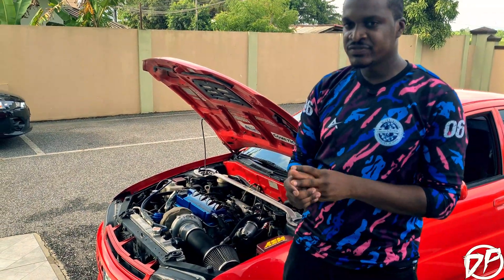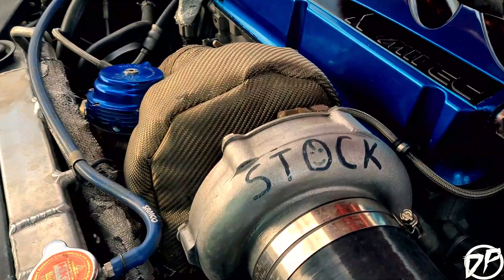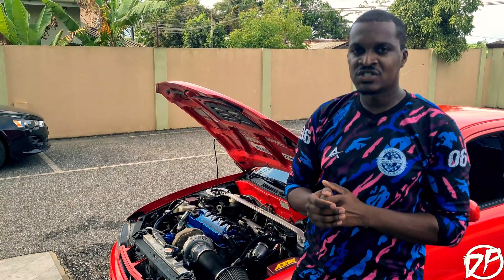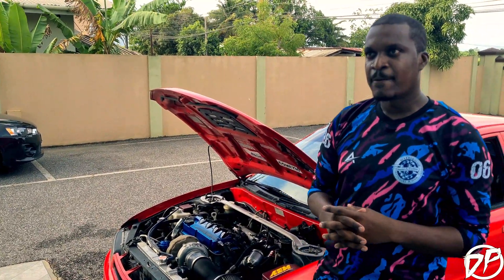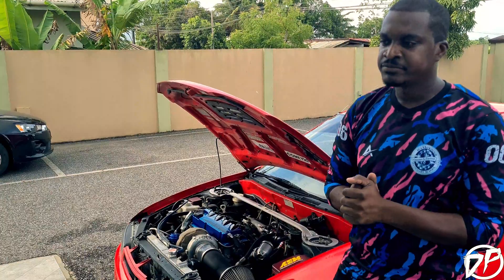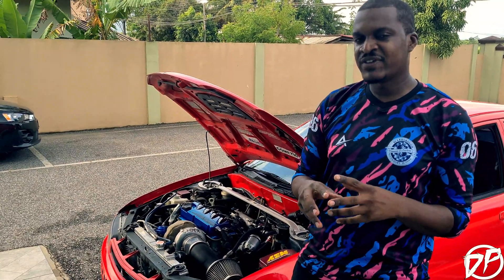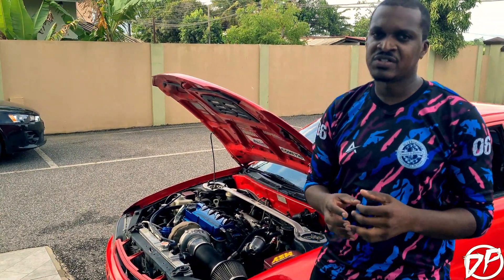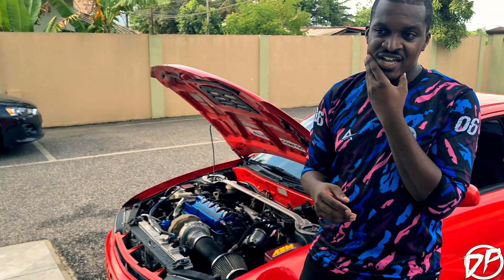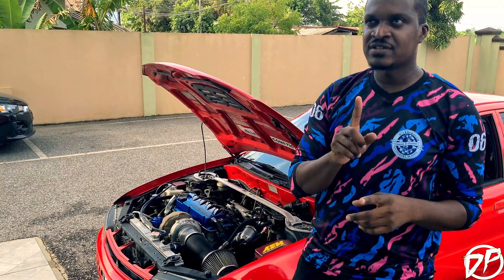Manifold made by myself. It's a Garrett T04E, E60 trim stock, but the front housing was upgraded by Chase from Point 14 — he did the billet wheel and front housing upgrade to a GT35. Basically the car with this piston combo is effectively a high compression build, at 10.2 compression. On 18 PSI, the most power I did was 434 horsepower — 355 torque, if I remember correctly.